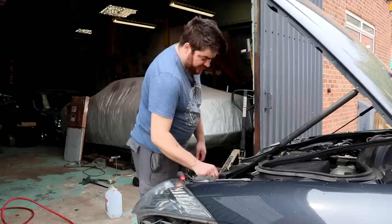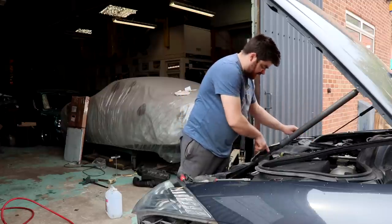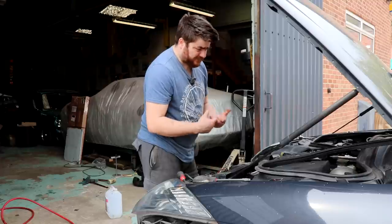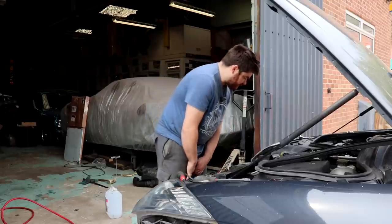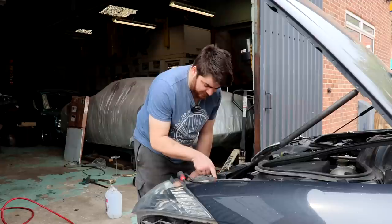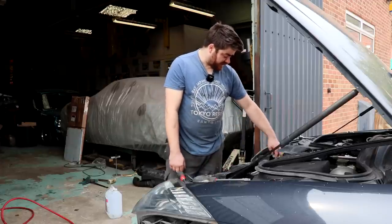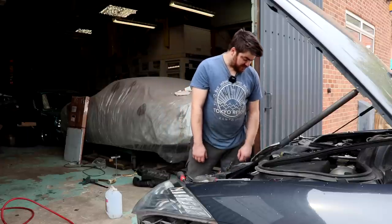The other thing I've got is a snapped fixing in the top of the rad pack there. I did have one on this side as well, but I managed to extract it, but that one is not coming out. And this is fiberglass, and there are captive nuts in there, and they're just spinning. Ideal. So really, I just want to get the captive nut out, and I'll just put a nut and bolt through it, but I've got to try and get it out without melting anything. So I think I'm going to have to grind the top of the remains of the head of the bolt down, and then grind the top of the captive nut off, and then just push it through the bottom. And this side here, I did get it out, but that's now spinning. So in theory, it might make sense just to get rid of that one as well.